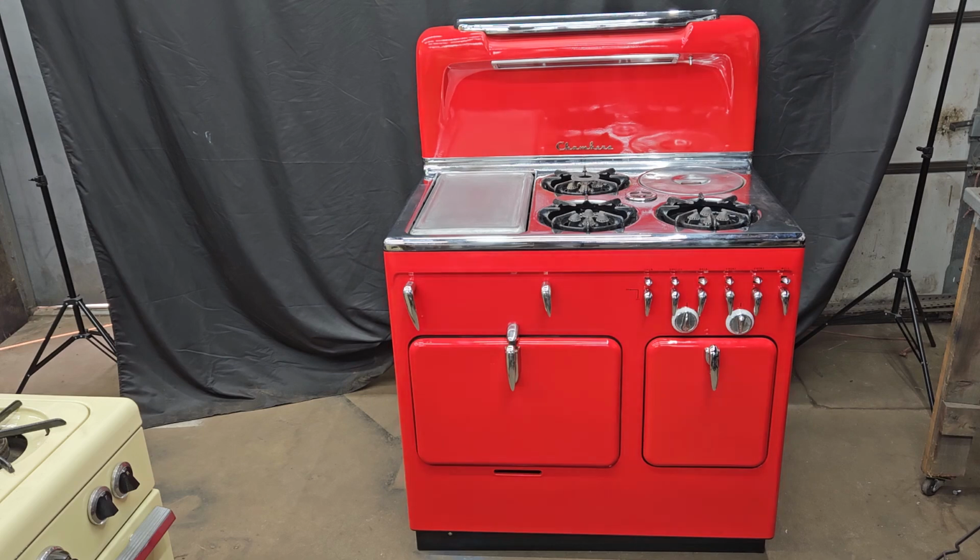With a properly functioning stove, this has no impact whatsoever on performance. The flow of oxygen inside the oven cabinet will be fine. Your pilot will be fine. It is really just a decorative option that you can choose, just like the original buyers of Chambers stoves back in the 50s opted to or didn't. I'd say about a quarter of the stoves that I see in their original place have the skirts and the rest don't. Choice is up to you, but now you know how to do it.